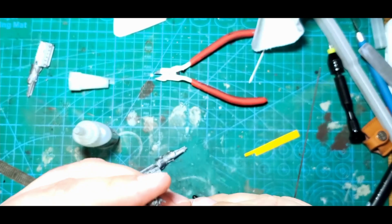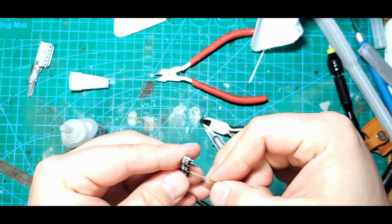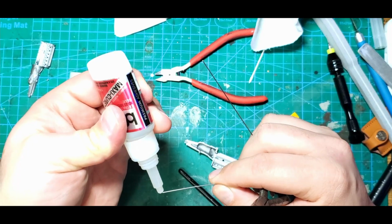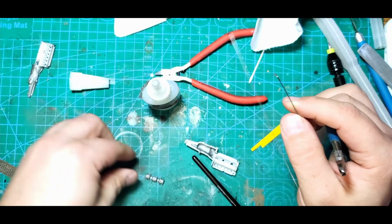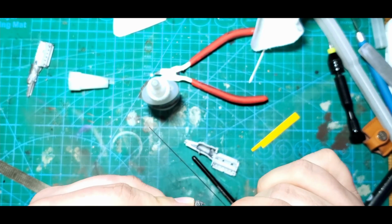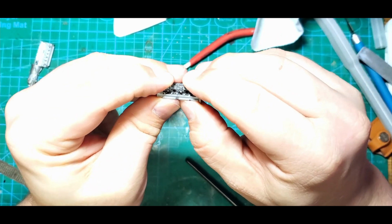With the holes drilled, we glue in and cut off some new pins using hard K&S music wire. One more test fit, then it's time to cut and sand the individual carbs.